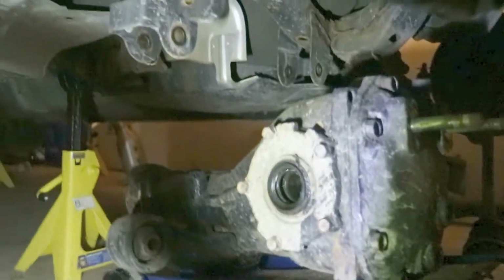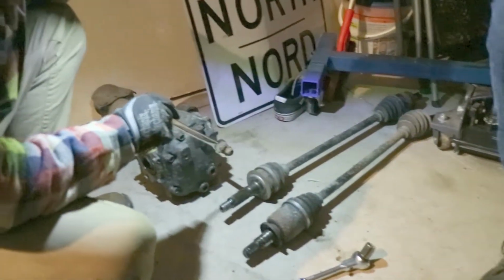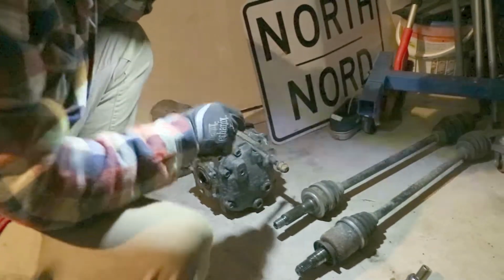And just like that, the diff is out of the car. Cool. So, we got the diff out, as you can see. Got the stock axles, 2 nuts tighten on. Take the studs out of this diff, and we'll put it in the new R180 limited slip diff, as you can see right there. So, we'll go back to work taking these out. I already got one out.